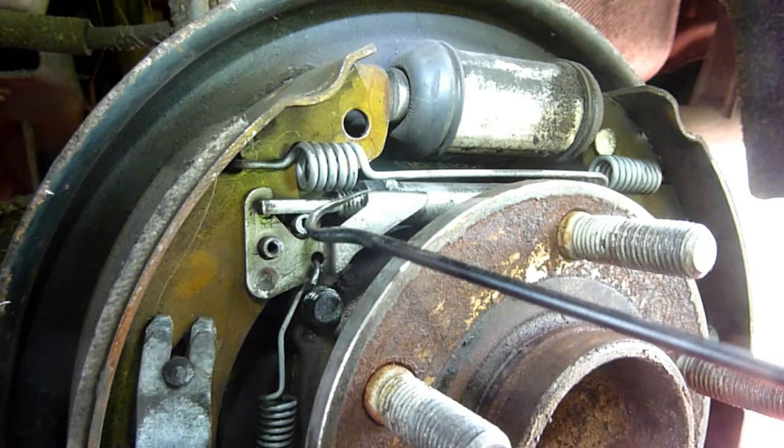Also, when there is load at the back of your car, that changes the way your rear brakes operate. The more load there is, the more the rear brakes come in. So load your car with something, maybe have someone sitting in the back, run it another few miles, and feel for heat. If your ratchet system is operating properly and you just left it at that, it should be fine. It should ratchet up in the right nice space, and you should be able to pull your handbrake and it will stop you on the hill, uphill or downhill.